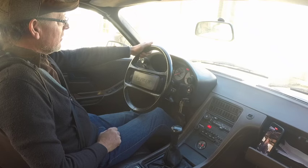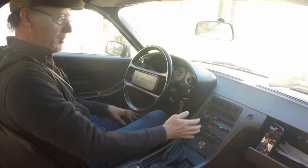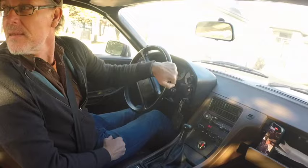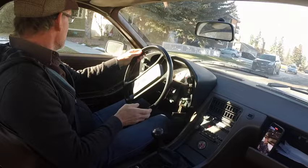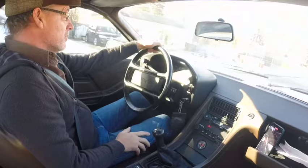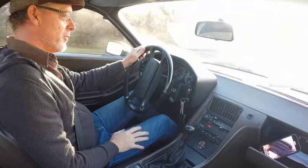It's been warming up for about five or six minutes. Oil pressure is at four bar, parking brake is off, we've got some heat in the engine — let's go. This is mid-November in Calgary, and it's actually fairly rare that there's no snow on the ground, so this might be my last chance to drive this car this year. The clutch take-up is nice — no juddering — and drivability is excellent, no stuttering or stumbling from the engine. The gearbox is slightly stiffer than normal cold, as you'd expect, but no trouble with the synchros.